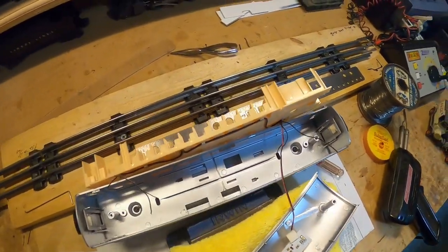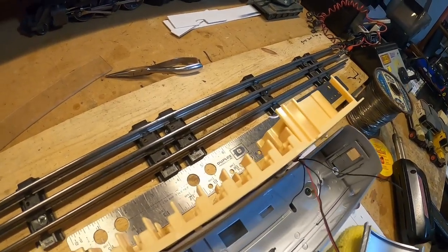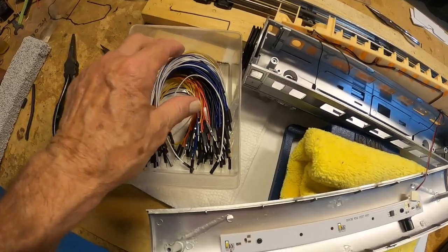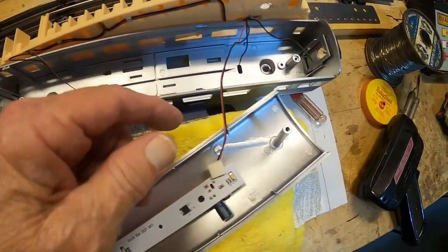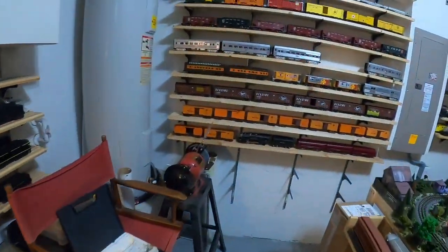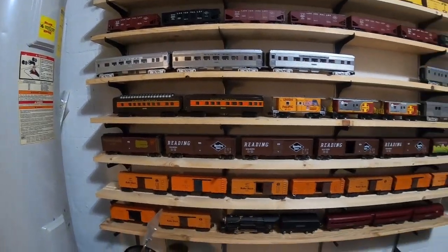I've got some heavy duty wires — I bought a whole bunch of them. They're over here and these are much thicker wire, better grade wire. I'm going to attach those here, bring them up in the middle and then run a splice for this ground. I'll run these two grounds in here and solder them to this heavy gauge wire. All my other ones work, but they're going to fail too. I've seen on Facebook and YouTube where these fail all the time because of the cheap construction.